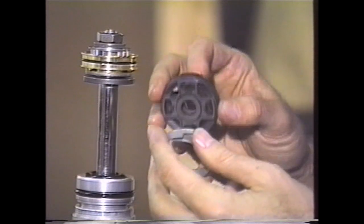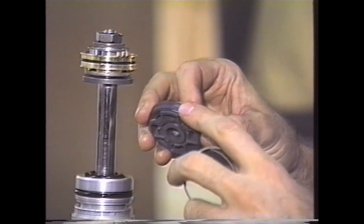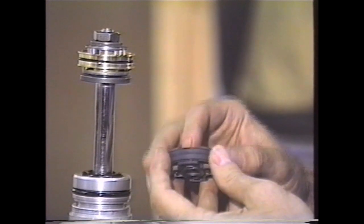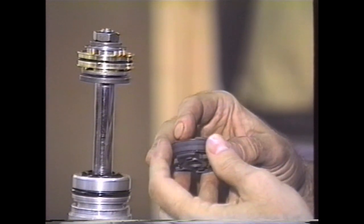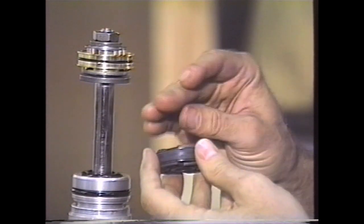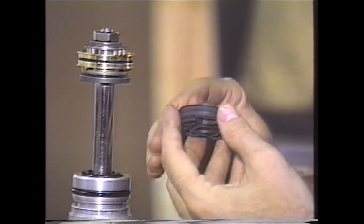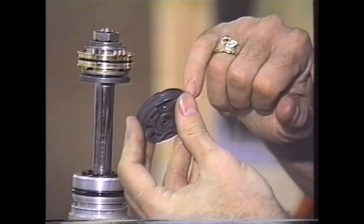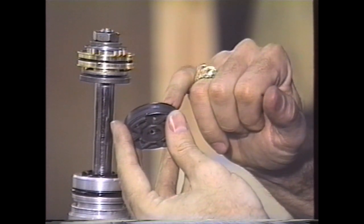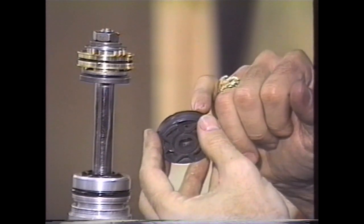If you're just doing a rebuild, make absolutely certain that the O-ring is in proper shape, and so is the piston ring. Another thing to check is the inside of the shock body. Sometimes bodies will become galled or even worn out — take a look at those, actually feel them with your fingers, and sometimes even take a dial bore gauge to check that it's not worn out. If this piston ring has been blown off or is no longer on the piston, you can be 100% sure that your shock body is worn out.